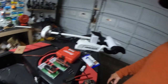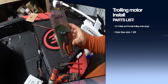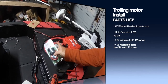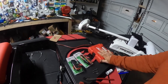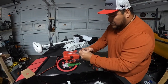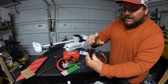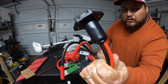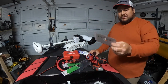Alright guys, back with you real quick. This is what you are going to need for this build out. First, you have to find yourself some 12-volt plugs — because my Minn Kota Power Drive runs off a 12-volt system — so you need one of these, the female and the male plug. For outside you will be splicing all this in. You're also going to need a hole saw in the size that fits. This plug right here is actually going to be on the deck, and you're going to have to make a hole big enough for it to land inside there.